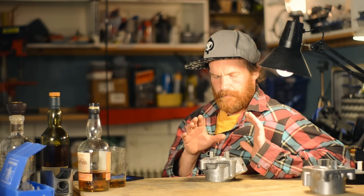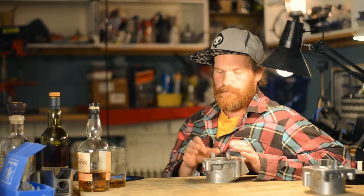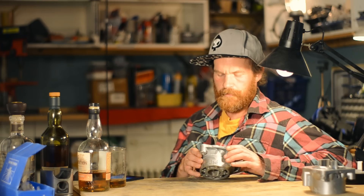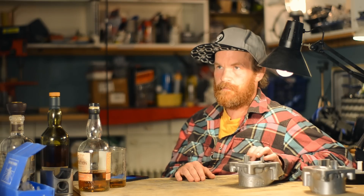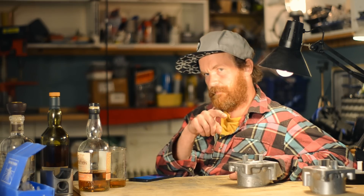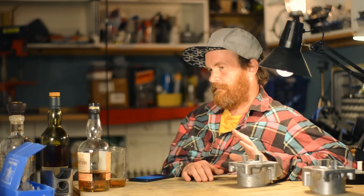What engine? The case will be custom-made, or I might modify the old SPX case. I might try casting a new block, or just machine it out of a solid block of aluminium — hopefully I can do that myself, but probably I'll need someone to do it for me. The crank will be from some scooter — haven't decided yet, but it will have between 39.1 and 39.7mm of stroke. Transmission: single-variator — you've seen it on the SPX.